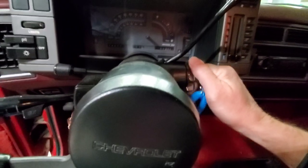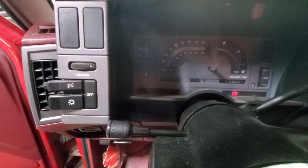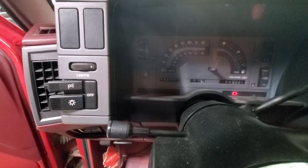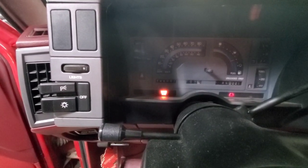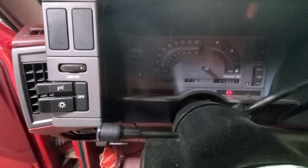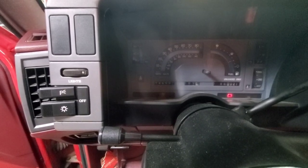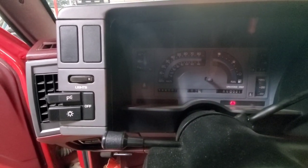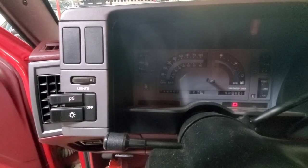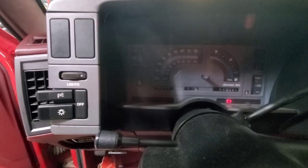So it's in all the way. Then we come up here and you'll turn your key forward without starting it. And we'll watch the blink. So that little 1, 1, 1 — and that little fast one in between there — it's actually giving me a 21. And if you let it go enough, you'll see the too-slow then the too-fast — that's a 22. And they are both throttle position sensor and some kind of fuel pump cutoff relay, which is on the firewall. I'm not sure where the throttle position sensor is just yet — I think it's on the air cleaner. But those are two things I'm going to go ahead and order and throw on here and see what happens.